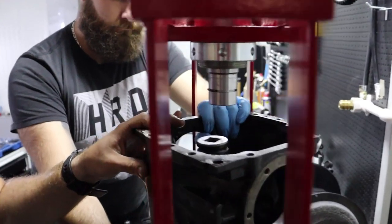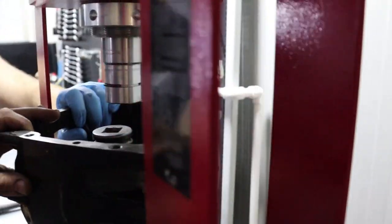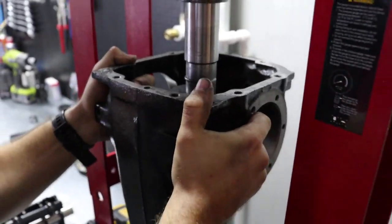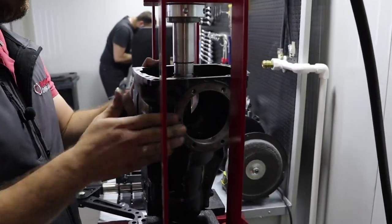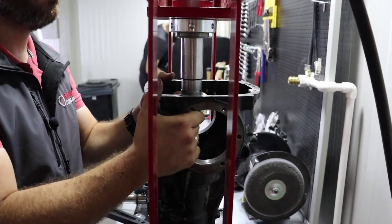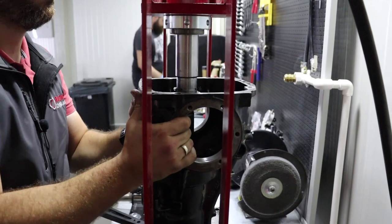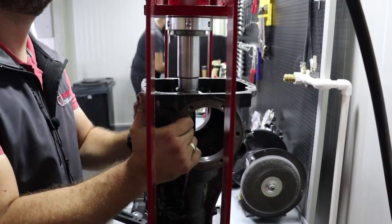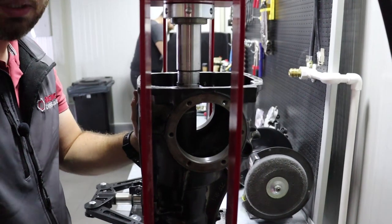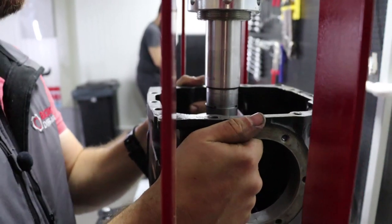And now you need to press down the pinion gear to small pinion bearing. Check for free play. Don't press it too much, because you have to leave some room for tightening of the input shaft nut. Another one. Be gentle here. Leave only a small free play between pinion and the housing. You will tighten it more easily.